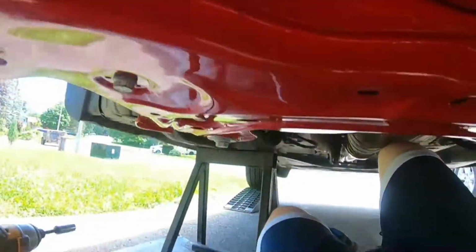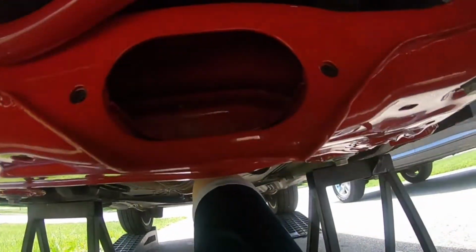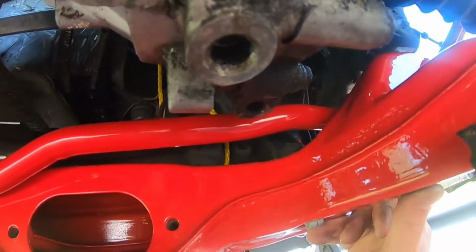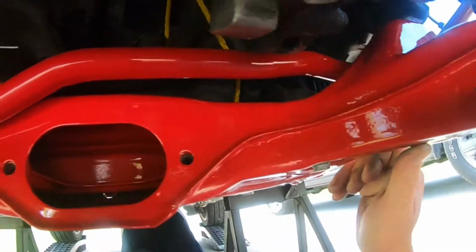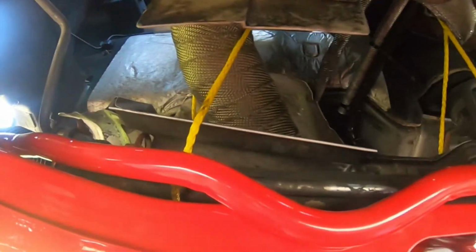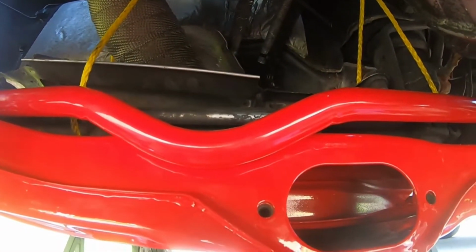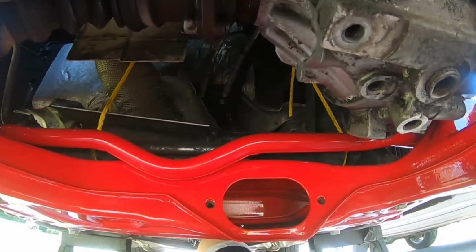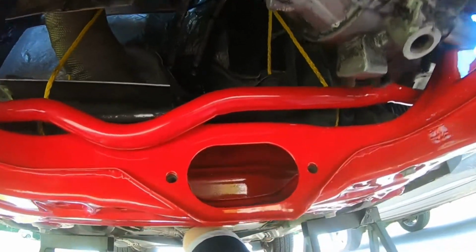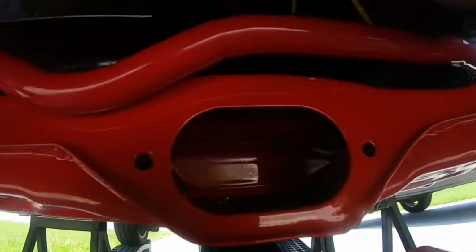Okay guys, so now the steering rack is fully secured to the subframe, and the subframe is still loose fit for now, just to kind of help when I put the control arms on. But yeah, that's finally done. So I'm gonna go up top, take off the rope, my little board there, which is nice. I can finally close my hood. I was getting a little worried that the hood was gonna fly up with some bad weather that we were gonna have, but that didn't happen, thank God. So yeah, take the rope off, and then that's all good to go here.